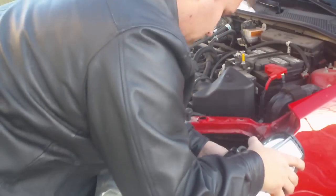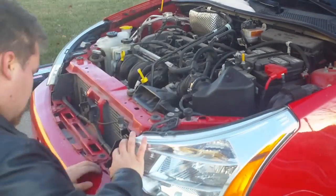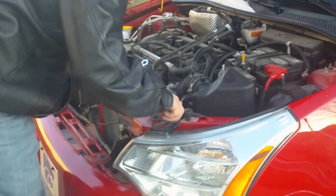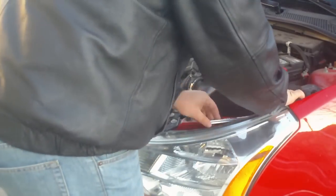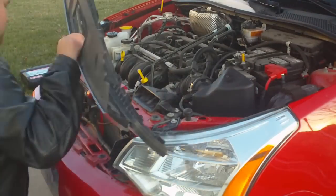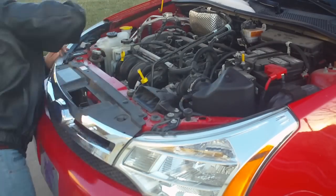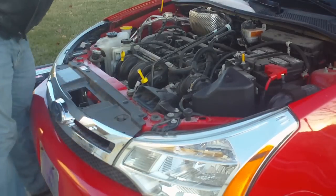After you're done, all that's left is to reassemble your car. Slide the headlight housing back into its slot — it goes in a little hard but you'll get it. Take your bolts and put them back in. Then you're just going to put your grill back on — for the bottom, just line it up and push in, it'll clip. Put the top into those little divots, then put back those plastic retainer pins. They go in really easily. Make sure everything's steady, and as soon as you do that, you're done.